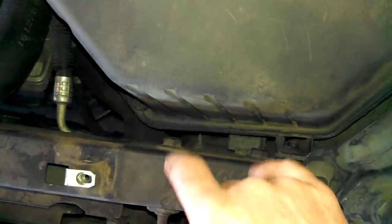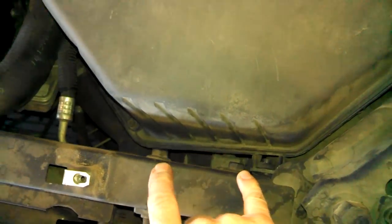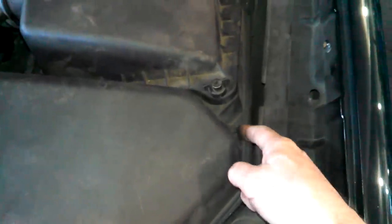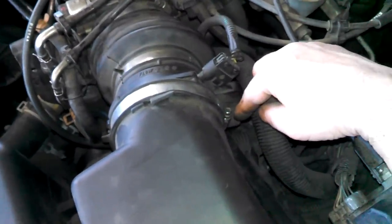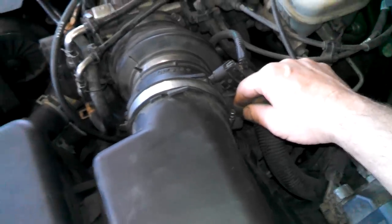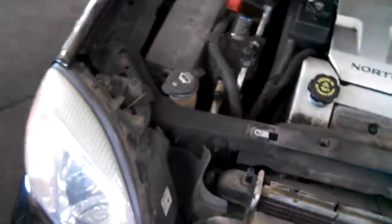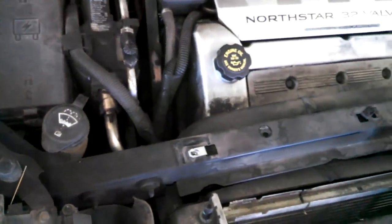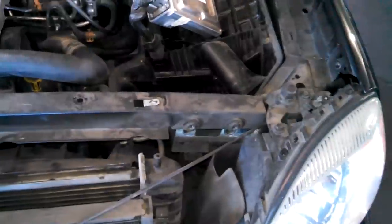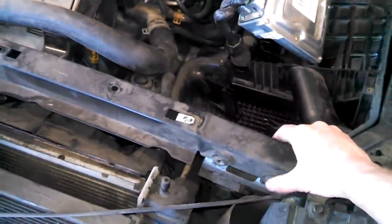Take this out so I can get these two bolts out here — that looks like probably 14 or 15 millimeter. Get these out with a Phillips or 8 millimeter or 5/16ths. And then these are wing nuts here. Then a clamp right here is a straight blade or 8 millimeter or 5/16ths again. You can take this whole assembly out to get room for the two bolts here. These two bolts over here should really be no problem at all — hopefully this thing will come out. 15 millimeter bolts, then just sliding up.